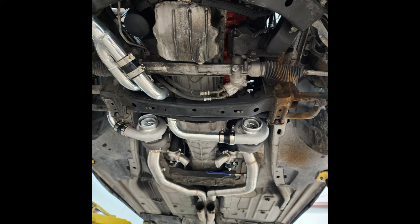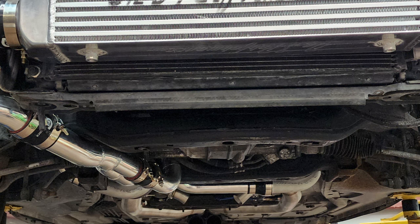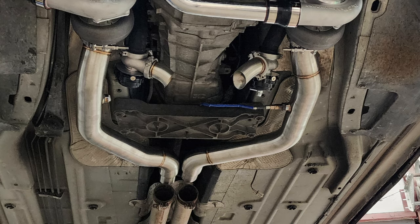The On3 kit is pretty darn good — I was overall very impressed with it. To sum it up, we put a set of 5.7 manifolds onto the car and then the On3 downpipes for the turbos bolt right up to that, and everything went really smooth. Very clean on the install; the turbos fit well, clearancing was good too. The piping is pretty darn good. The instructions could use some work, but someone with experience doing turbo stuff can put this kit on no problem. You guys will see later in the video we do get to dyno the car — it puts down some good power.